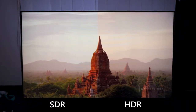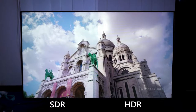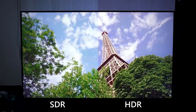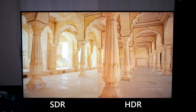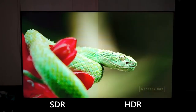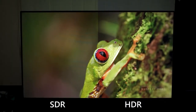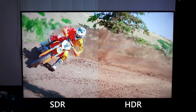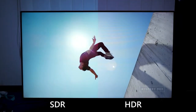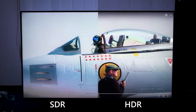But in our case, we don't have the Series X with us, so we ended up using a PC instead. A Windows PC in general is quite okay in terms of handling HDR, but finding HDR content is another issue. Luckily, you can still get some HDR content on YouTube. If you want to test whether your HDR is working correctly, you can use that. Personally, I think the best way to test HDR on the Windows platform is with HDR capable games. So we tested some games.